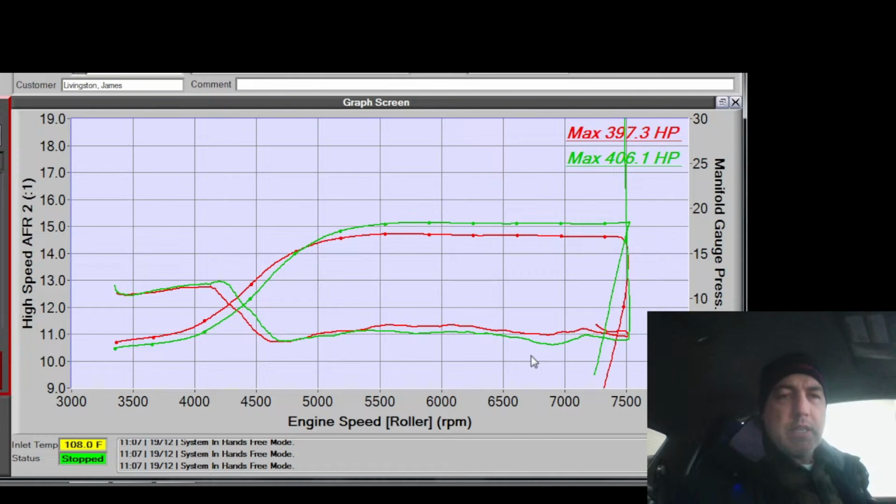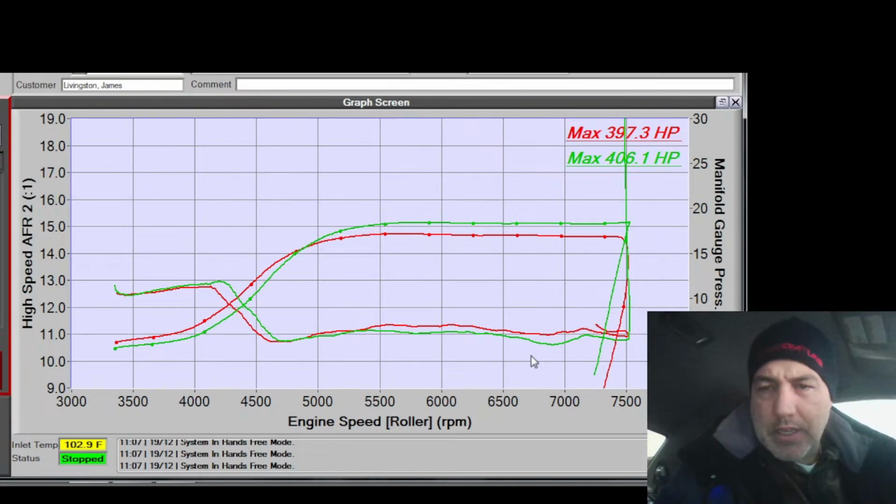The rest of the pull was clean though, no issues anywhere else on it, other than me over revving it a smidge when I let off to push the clutch and not giving it enough throttle lift. She went vroom. I don't know if you heard it. Knock down this line of timing here. Right there. And I might hit some right here too. Just in this area gets a little more linear, a little smoother.